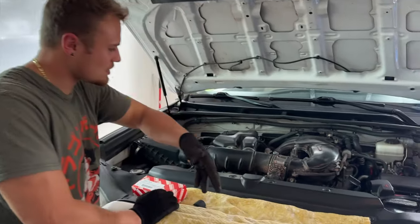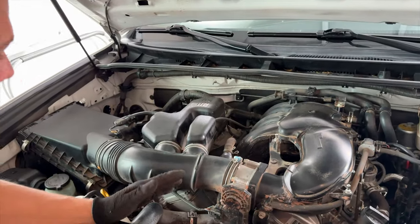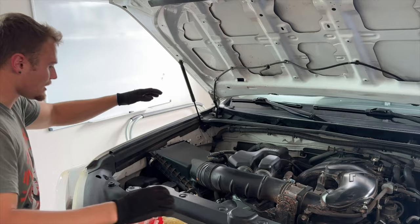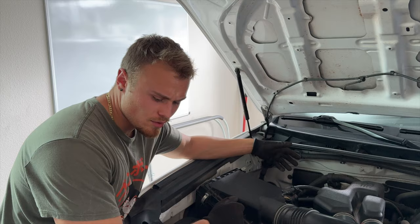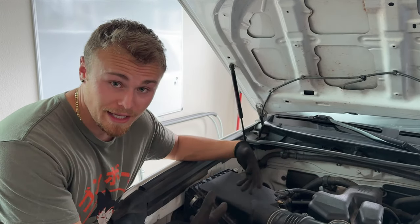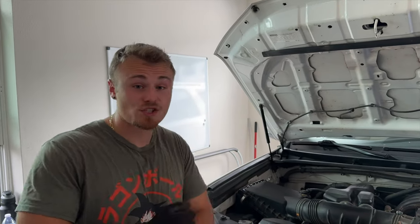You can see the way this engine is positioned, connected directly to the transmission with the belts on this side. I'm 90% sure — correct me in the comments if I'm wrong — but bank one is on this side and bank two is on this side. Cylinders one, three, five on one side and two, four, six on the other. We need to replace the O2 sensor on this side. Bank one sensor one means it is above the cat, not after it. This is the important one because it tells the engine how much fuel and air it actually needs.